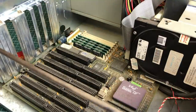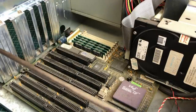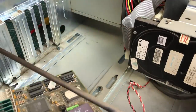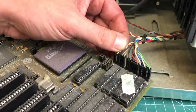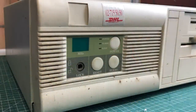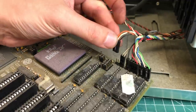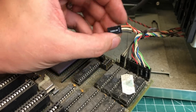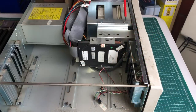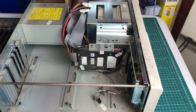This is one of those boards with the infamous Varta batteries, which will leak all over the place — and that is indeed the case here. Let's pull off the motherboard to see what damage the Varta battery has caused. I can already see some green corrosion on the power connector, but that's probably going to be the least of my worries. On the motherboard we also have cables that hook up to the front of the case for the reset button, turbo button, power LED, and hard drive LED — so it's best to take a picture of those. We're also going to be removing the hard drive, which is mounted here on its side next to the bay for the three and a half inch disk drive.